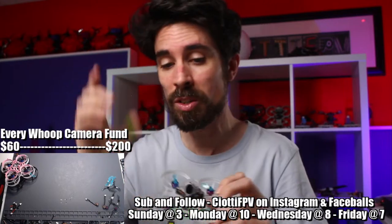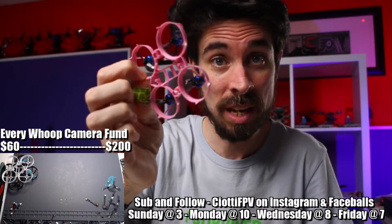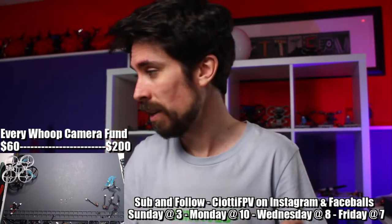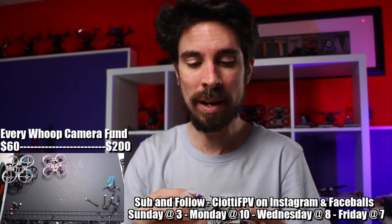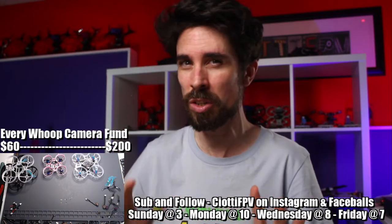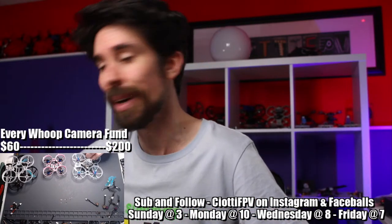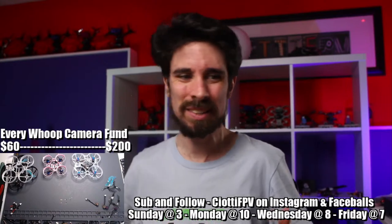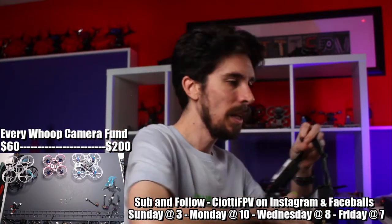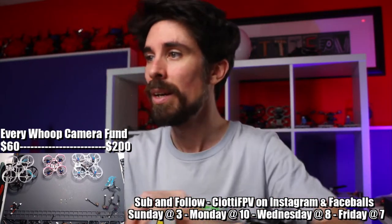802 30,000 kV motors. Next time, we will test 802 33,000 kV motors. That's what I'm most excited about, to be super honest. But this was good to double check, because 0603 is a super interesting motor. I didn't want to, but that runtime, a minute and 20 seconds, and a minute 26 seconds, that's too short. That doesn't work. You gotta draw the line somewhere in terms of runtime.